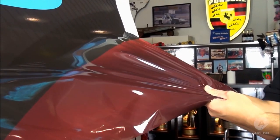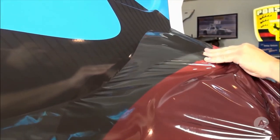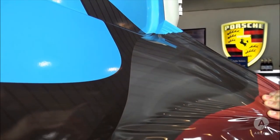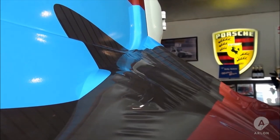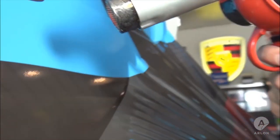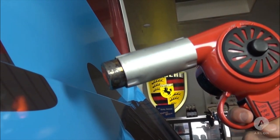Pulling the vinyl at about a 15 to 20 degree angle gives you the best result. Spread your fingers out, putting even tension across the vinyl. Pull down with your second hand to add leverage as the area you are removing becomes bigger. As the edges of the heated area cool, stop pulling and begin the heating process again.